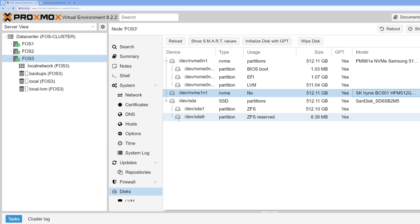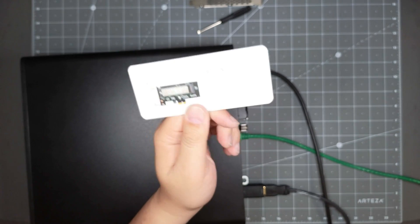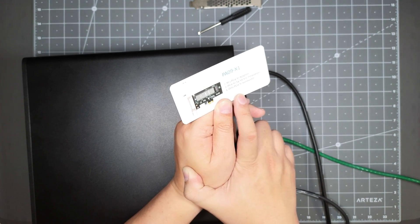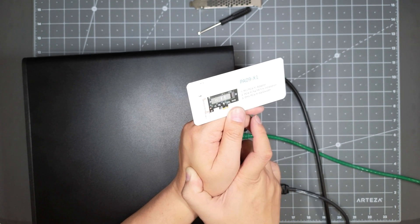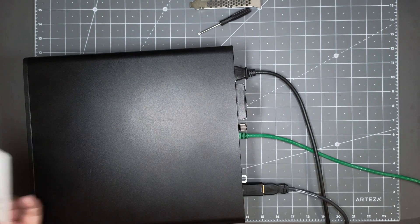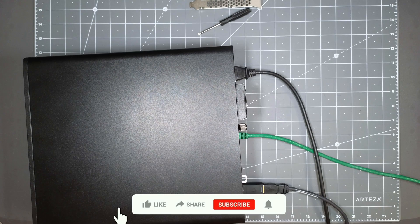So if you have a 1x PCIe slot, you could get this adapter and it's pretty good. If you have an extra NVMe, you could just turn that 1x slot into another hard drive's worth of storage. I believe with PCIe NVMe it's still a little bit faster than a regular SATA SSD. The speed is not too bad from comparisons I saw online. That's the unboxing of the Glowtrend PA09-X1, which is already up and running in this computer. If you liked the video, you guys know what to do — and as always, thank you for watching and I'll see you guys in the next video. Peace out till next time.